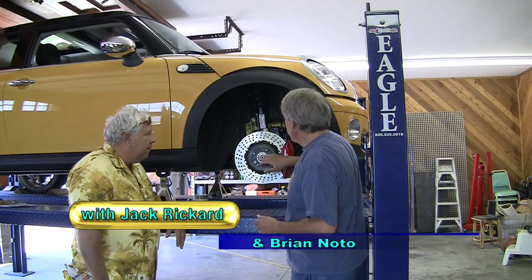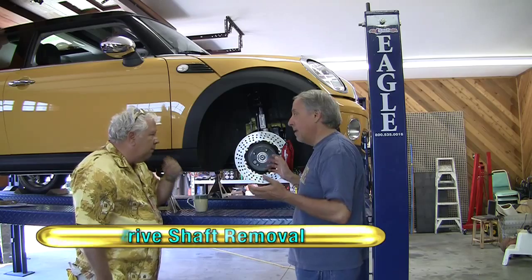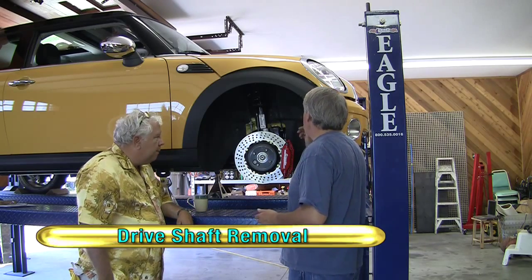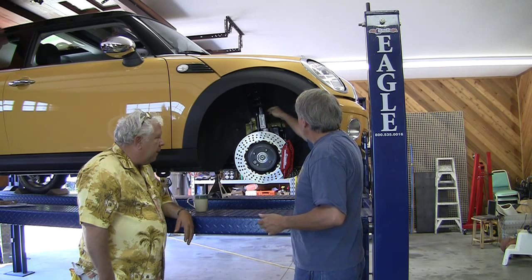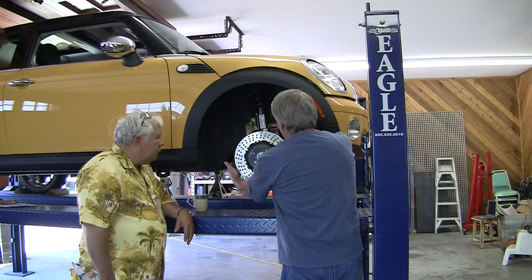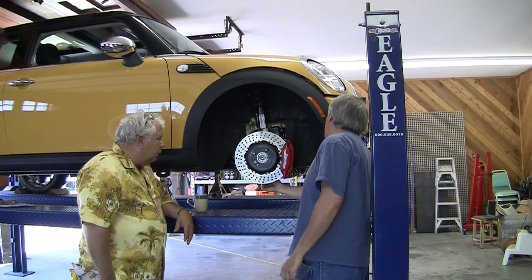What's the procedure here? What we've got to do is allow the shaft to pass through this whole steering joint here. We've got to loosen it all up and swing it out of the way. We're going to take this stabilizer link joint out up here right behind the strut tower, loosen behind here - there's a tie rod end that we're going to take off. Also under here there's a joint that attaches to the steering knuckle.